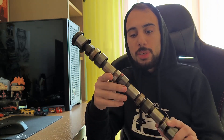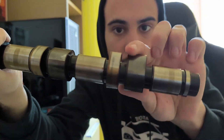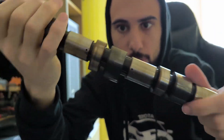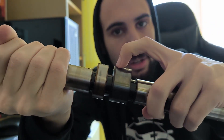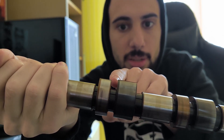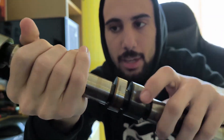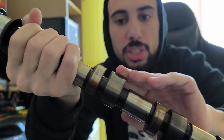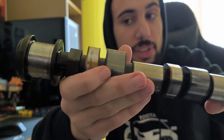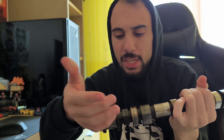I personally just swapped mine with OEM used ones — let's see how that goes. This is an exhaust side camshaft and it's the best example of a great cam. That's how your camshafts are supposed to look: shiny, no sharp edges, completely polished, completely straight. My fingernail is not getting stuck anywhere. There might be a brown or black line here and there, but I cannot feel any groove — it's a completely perfect cam. That's most of the time how the exhaust one looks; it doesn't get wiped because it has great oil pressure.